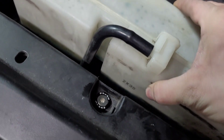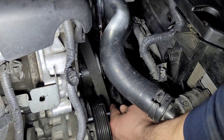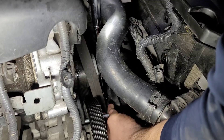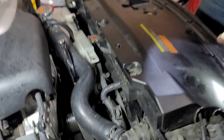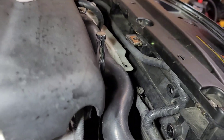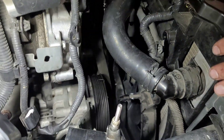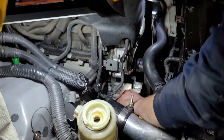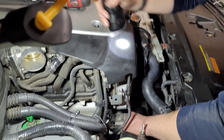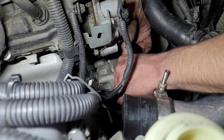This is completely free now — it was actually snagging on the bolt itself. Now we have the fan shroud pushed down enough that he can actually pull the bolt completely out. You do have to loosen up the fan shroud and the coolant reservoir just enough to get that bottom 14 millimeter bolt out. We already have the 12 out, and now he's just working on pulling the pump completely out of the car.